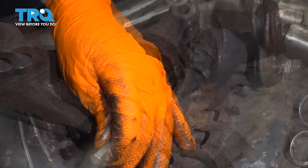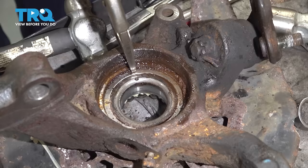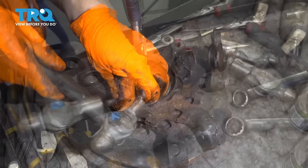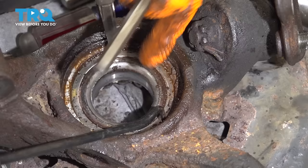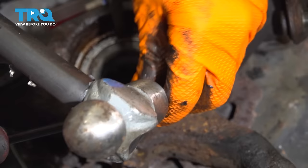Or it'll break it. My end broke on that side, so what I'm going to do to get this snap ring out at this point is use a pair of locking pliers and lock it in really tight up against the knuckle. That's going to prevent it from spinning as I push in that end. It's moving but it's springing right back, so with the help of my coworker, I'm going to punch this in. I need a third hand to put a pick right there — once I hammer, it's going to drop the pick in and lock it down, preventing the snap ring from going back into its hole.